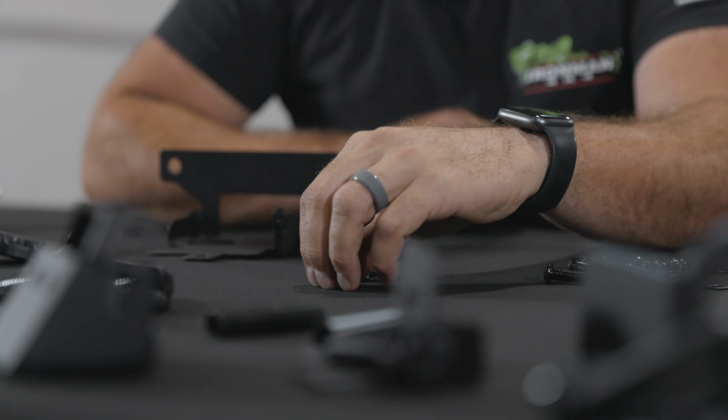Now, as you tighten this down, you wanna watch for those little Pac-Man ghost spacers, because if they slip out of the pocket that they're in, you could tighten it down and crack the plastic housing on the radar. So watch for that. Snap, just kidding. That is how that should look. See, and then you got some adjustability there.